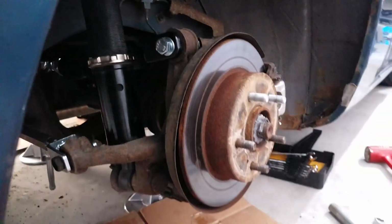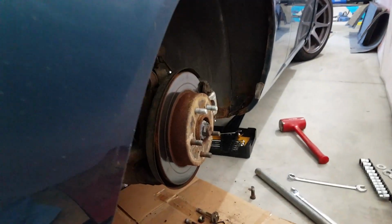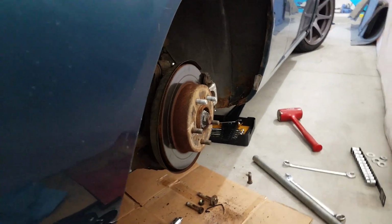On this other side, it's all installed also. I torqued down those rear inside bolts. And I gotta kind of lift up that wheel and then torque down those, because they're like the rubber bushing still. I don't really want it to bind. And I'll lower it down, and then try to align it myself.